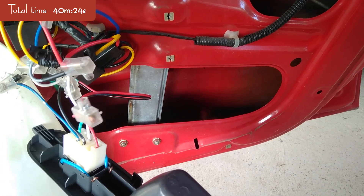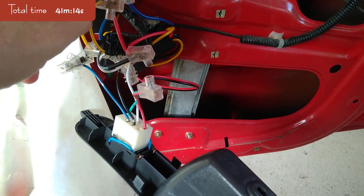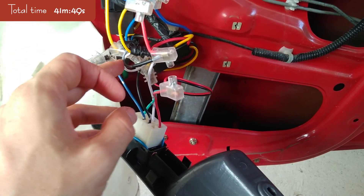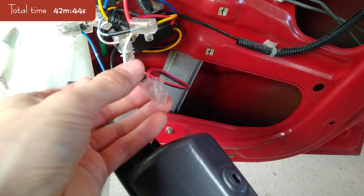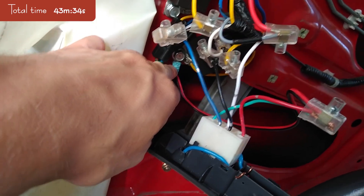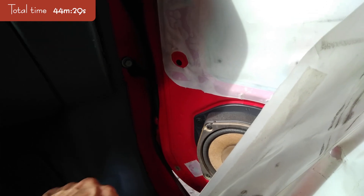The other one is the blue wire — this blue wire will get activated by the second relay, which should go down. We have power wires: one to this relay, the other to that one. This one is the power that comes from the driver's side, and then this one goes to the switch. The last thing I did was the ground through the switches, and I also had to hook it up to one of the bolts. I took this bolt out and added this in, so now I should also have the ground here. I checked the ground — this bolt also has the ground because it is going directly to the chassis.